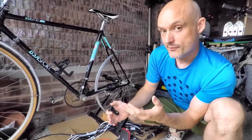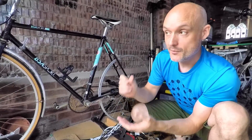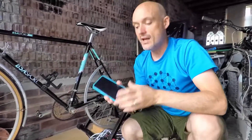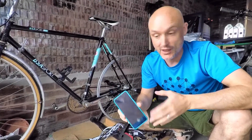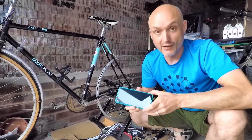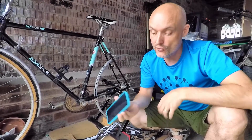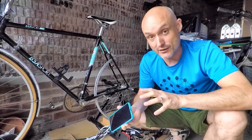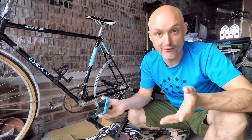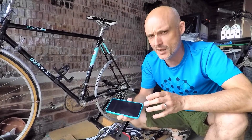What you can't do — if the phone isn't designed for it — is increase the current to charge it quicker, because every phone has a rate that it will charge at based on the battery technology in the phone. So you can't charge it quicker by forcing more current into it; it doesn't really work like that. The phone will only draw the amount of current that it needs. In fact, you could connect it with a suitable inverter direct to the output from a power station and it will still only draw three amps or whatever it takes — it simply won't draw any more. Voltage might be an issue from a power station though.